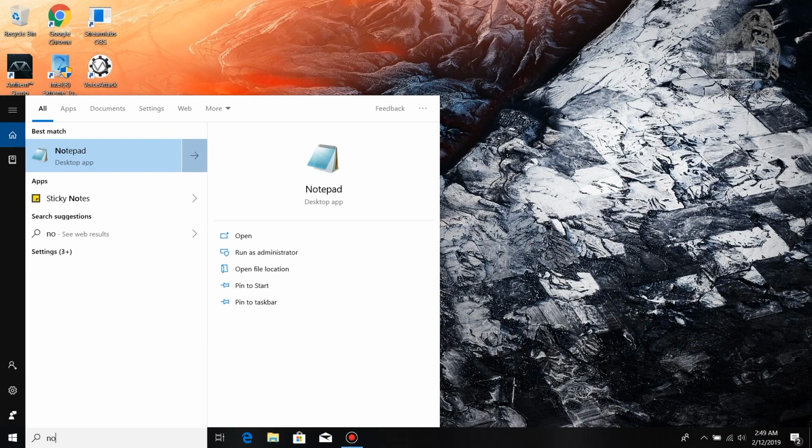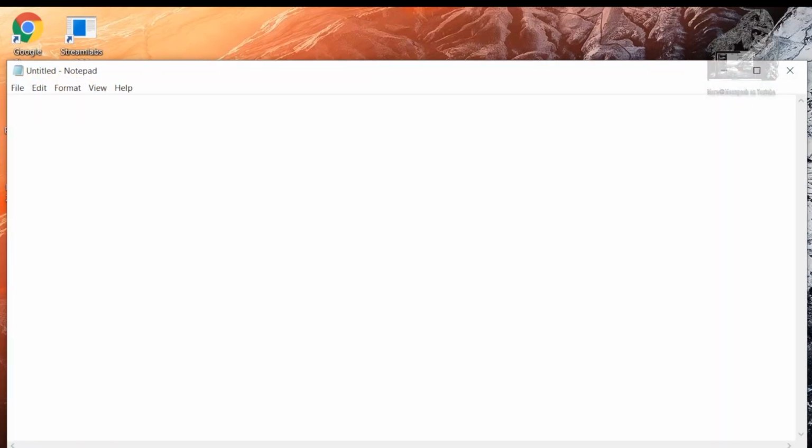Let's start by opening Notepad and follow me as I type this. You may have to pause the video to make sure everything is correct on your end. Make sure on line 3 that the location of the Intel Extreme utility matches what you type. If you did not install to the default location, then you may have to adjust. This is basically telling the XTU, when started, to apply the undervolt settings.